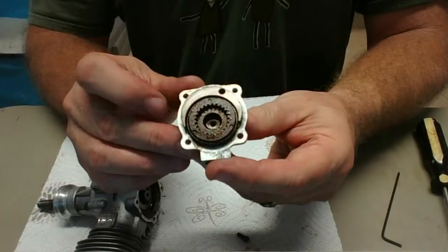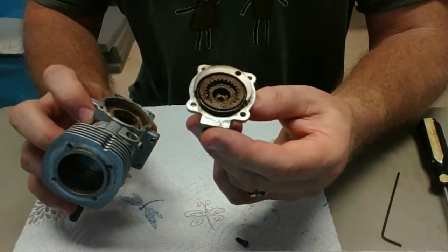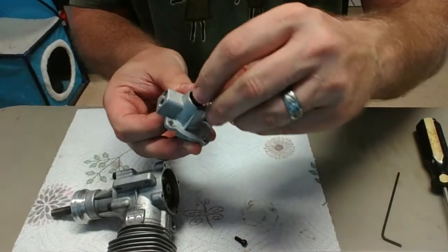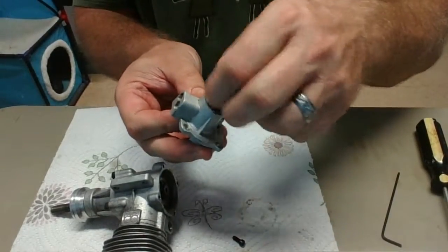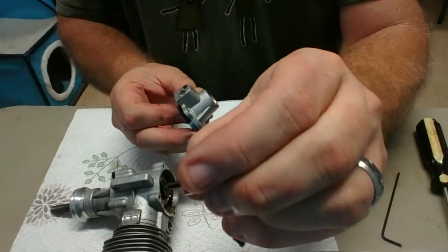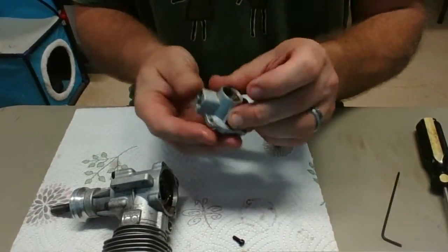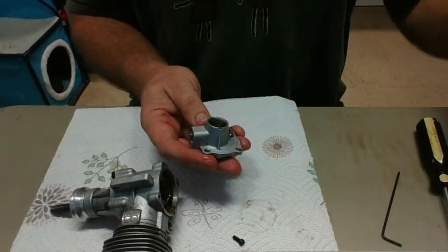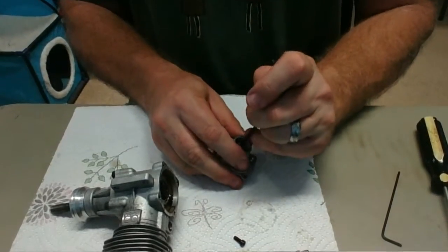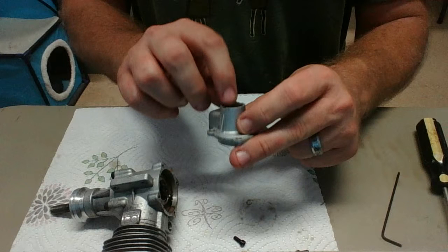There's a diagram I found online that tells me this is the timing gear. The dots on here tell me how to do the timing — it's all based off the crankshaft being at top dead center. I'm not too concerned about that right now since I'm taking it apart, not putting it back together. You can see I forgot and started going the wrong way, screwing the thing back in, because it's a left-hand thread. So that screws out — and it's not the beefiest screw around, made of pretty brittle material that's easy to break. This shaft should just come right out now, though it may require a bit of nudging and I may have to tap it out at the workmate.